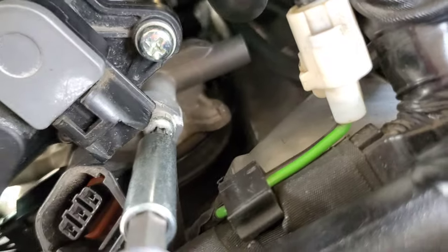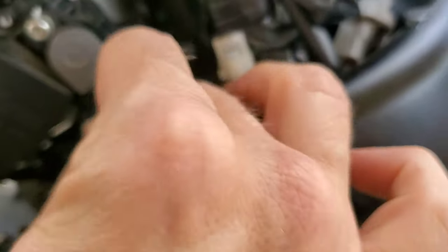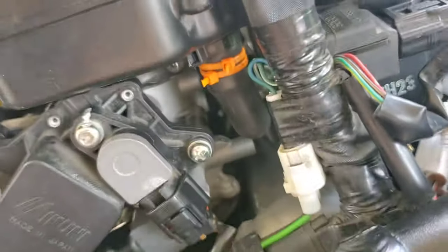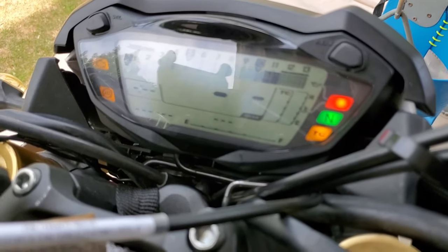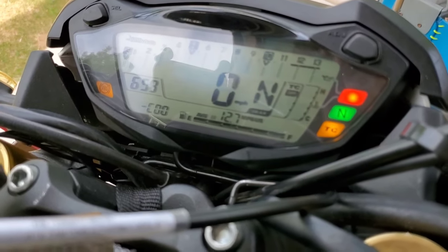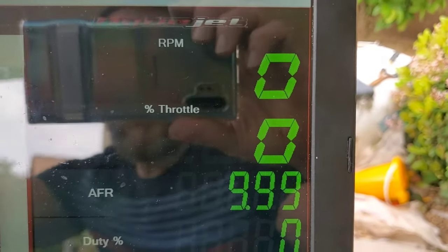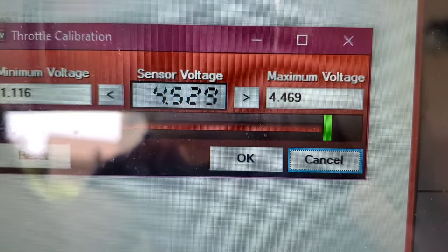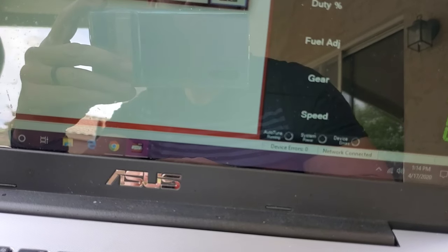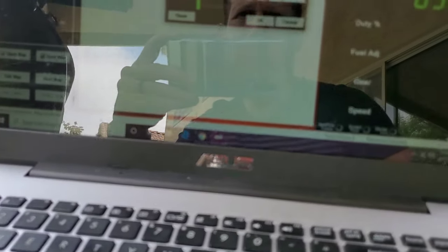I think I'm done — I'll double-check by turning on the ignition for a final tighten. I'm putting the connector back. I didn't actually need to remove it, but I didn't want to stress the cables. Now I'll check my work: turning it on — the indicator is right in the middle, the fault code is gone. I'm reading 1.12 at zero percent throttle and 4.5 at wide open, and the maximum voltage shows 4.4, so it's right on the money.